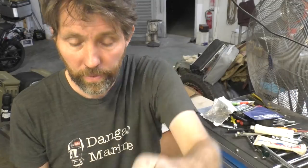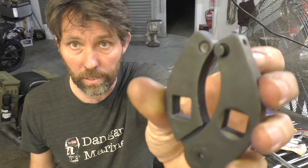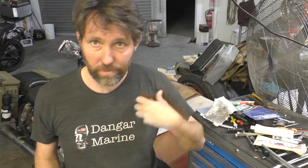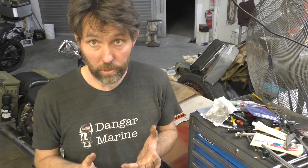Then I've got a variety of these sort of face spanners — just two points like this, or this, or this style — for doing things like taking the caps off the trim tilt units. Doesn't matter how many of these I have, I still can't get them to fit most of the time. Often you do need the one the manufacturer sells. Be careful with these too, because those caps can get really stuck. One bit pretty badly when the pin broke — you're putting a lot of force and then ended up tearing your shoulder. So they're a fiddly tool and often you have limited success. By the time it's 20 or 30 years old, it's a bit hit and miss.